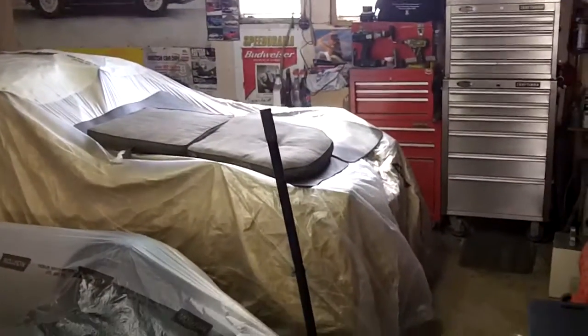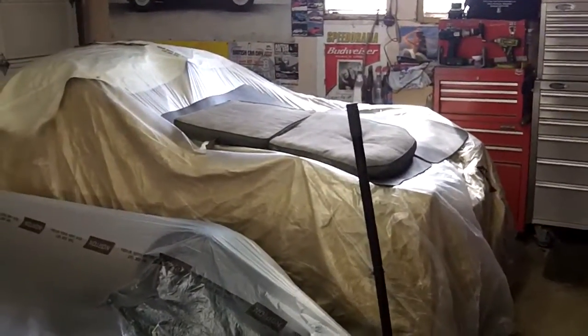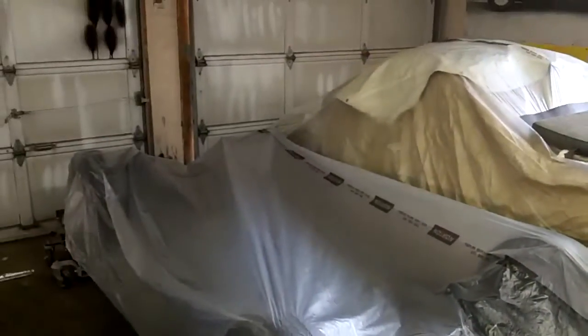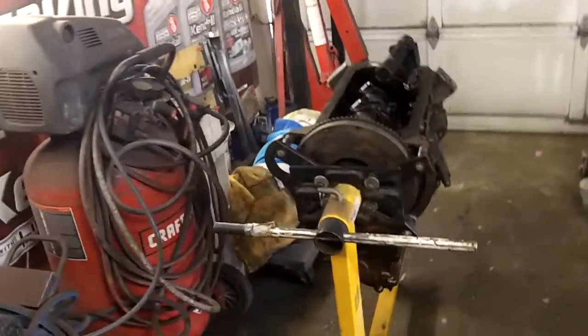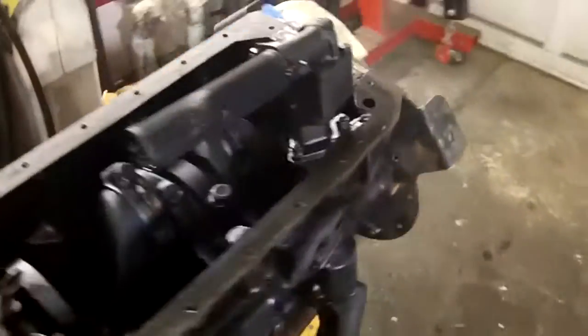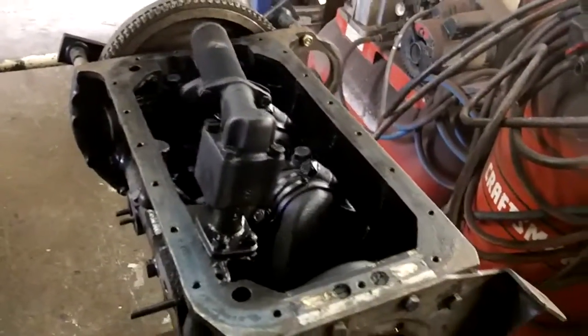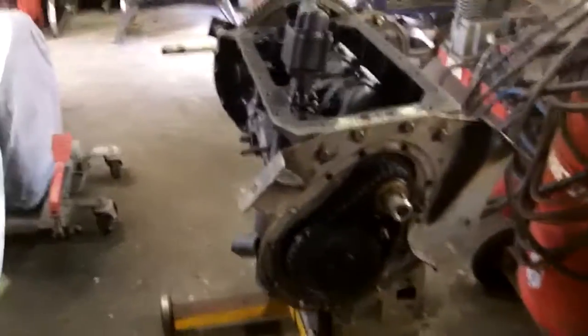Back in the garage, Monday April 13th, another nice day. We've got the car, the 60, covered back up with covers and plastic, and the frame covered too. True to my word, we're going to start working back on the engine and get it ready for paint. First thing I'm going to do is clean up the bottom edge with a scraper and get all the old gasket residue off, so when I put the new gasket on we'll get a good seal. Then we'll flip it over, continue to scrub it down, degrease it a couple of times, scuff it up with the scotch-brite, and then get it into paint.